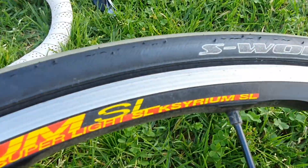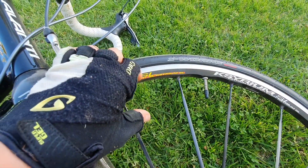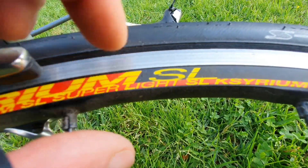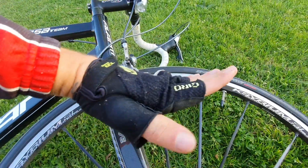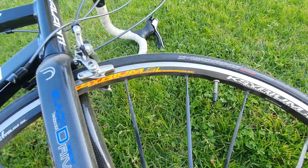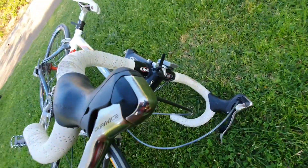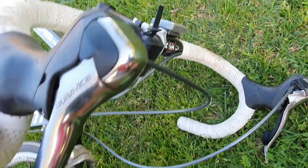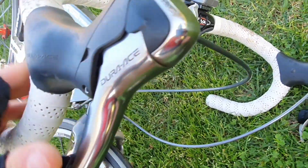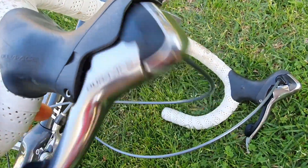Front wheel - fantastic condition, it just needs a bit of a clean up. You can tell the condition of a rim by feel - you can feel the factory etching still there. When a rim's worn, it gets really concave and gets like that, like a duck's beak. When it's brand new it's dead flat, and over time it wears, but you get a lot of usage out of them. I've got a little speedo on here - I'll give that to someone in the Philippines or Thailand. And the shifters here - the condition of the shifters looks fantastic. These Dura-Ace 7800s, I'm a big fan of them. They're not really worth much anymore because they're quite old - you might get 300 bucks for the group set - but they are a nice shifter. I do like these and they're in great condition, so the bike is well looked after.